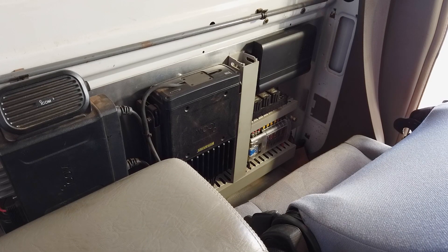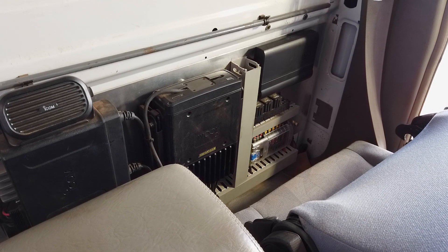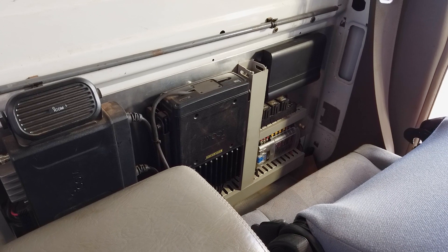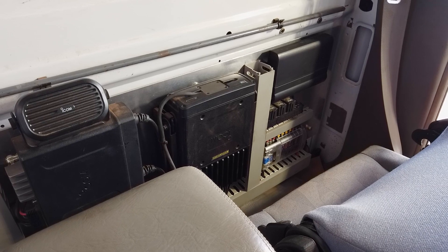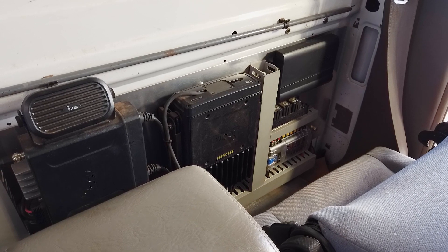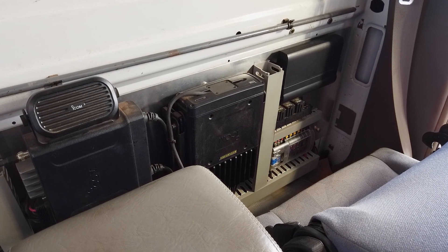Here we have a typical commercial installation of LINX. In this vehicle the LINX is installed on an aluminium escutcheon panel to the rear of the cab, allowing the mounting of LINX and all the other accessories directly to the vehicle without turning the cab into swiss cheese. On the right-hand side you can see the LINX module installed along with a relay panel that provides higher-current switching for accessories, as well as the Bainbridge Technologies fuse panel at the lower right.